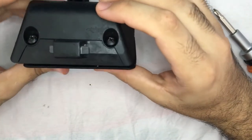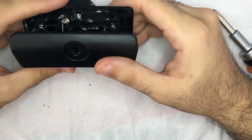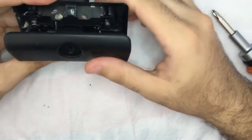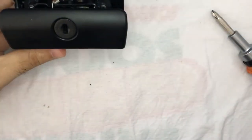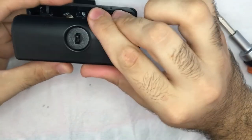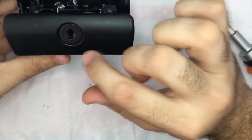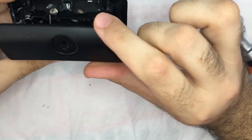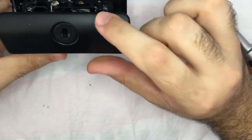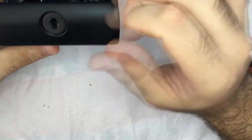Boxes. Here I have the lock of my 2002 330 convertible. Glove box, okay. And as many of you know, the E46 glove box lock usually breaks. In the case of the convertible ones, it has an electric mechanism that locks the latch in place when the soft top is down, and you can't get it open even if you try with your key. It will not open until the car is unlocked.